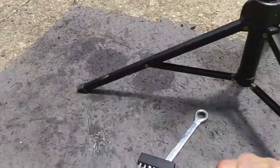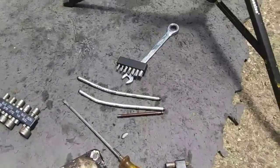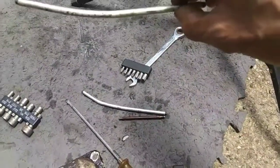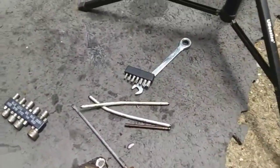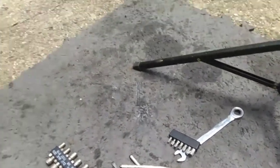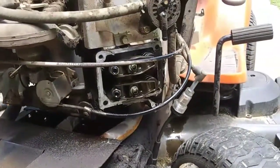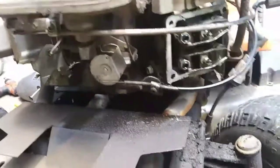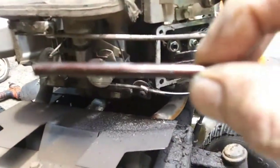So that tells me whoever was in here before me has made this repair before, like the guy said, and he knew that it was missing an intake push rod and just went ahead and replaced it with another one, not keeping in mind that that was just going to be flopping around in the engine. So whoever did this repair obviously didn't care at all. So now I have no choice, in good conscience, because I can't find the other half of this. And now it makes me wonder what else might be in there, or what kind of damage.